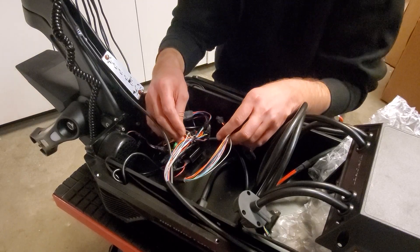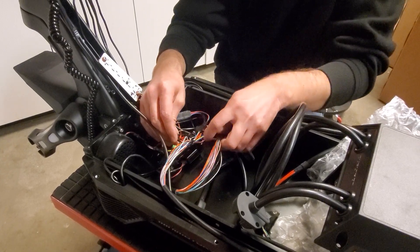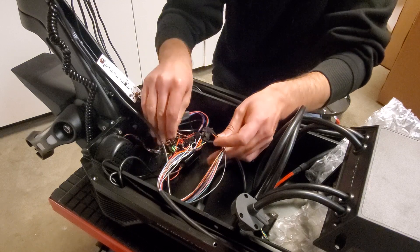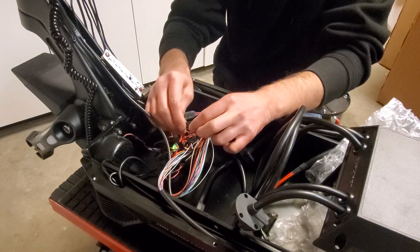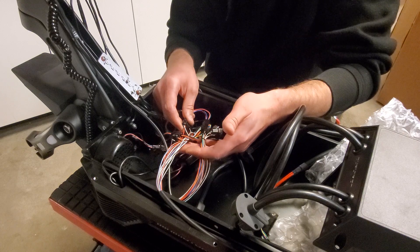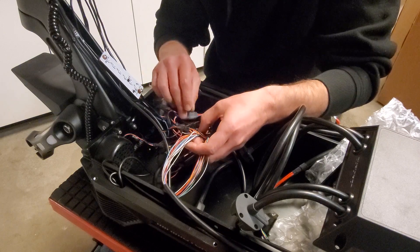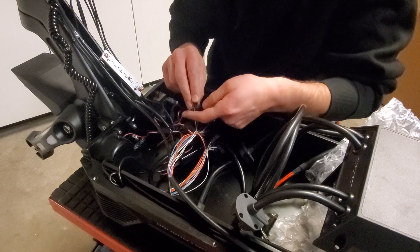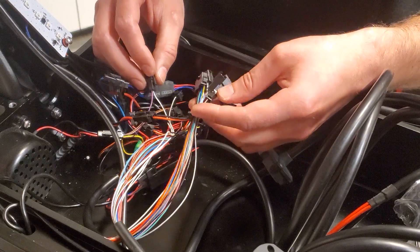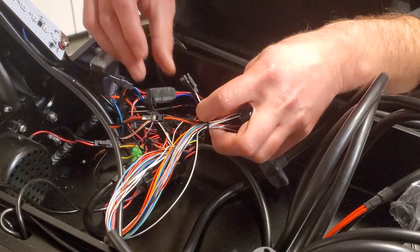At this point, you're going to want to get your new controller in place and hook up the new wires. You're going to want to do a one-to-one replacement for each wire — unplug each wire from the scooter side and plug in your new connections. There are a few wires that you're not just going to be able to unplug and plug back in. One of those is coming out of the multi-switch — it's this small purple wire right here. You're going to need to get that wire out and plug it into your new controller side JST, just this single white side.